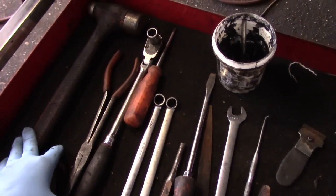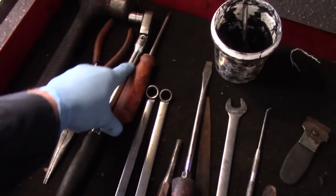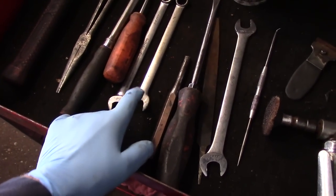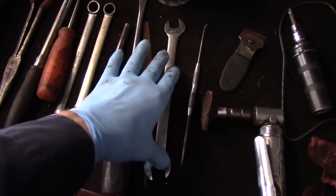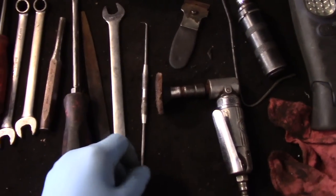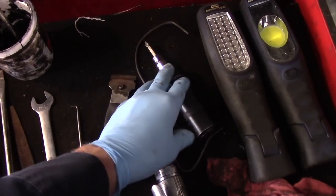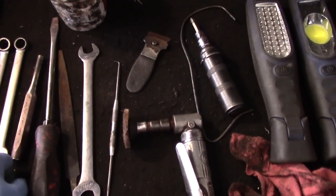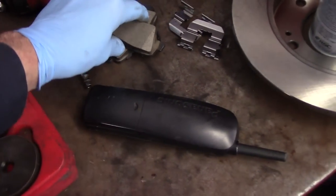This is an example of what kind of tools you're going to need for the rear: a hammer, a very long pair of needle nose pliers, a ratchet with the longest extension you have, a 14mm socket, Phillips head, possibly a 14mm wrench, and believe it or not, a 9/16 wrench — and I'll show you why in just a minute. Also our driver, screwdriver, a file, a thin wall wrench, something to hold the caliper up out of the way, and something to clean up the hub. Some synthetic brake grease, a new rotor, and new brake pads. And this is the tool to actually rotate the piston back in.